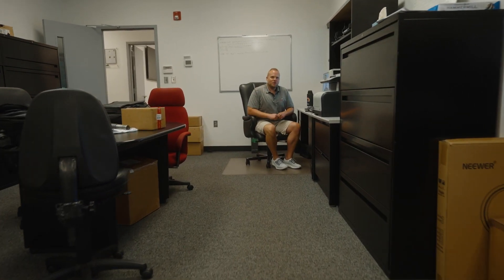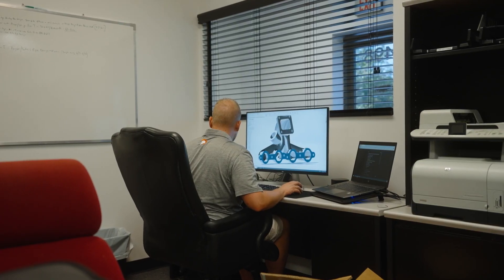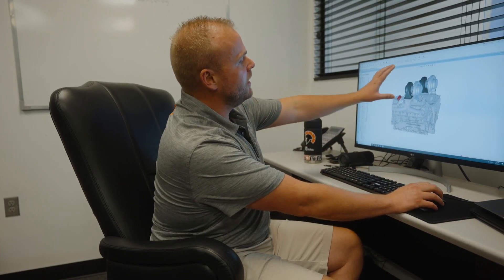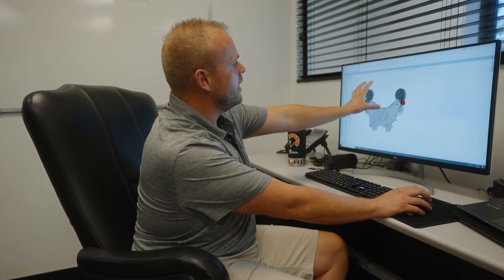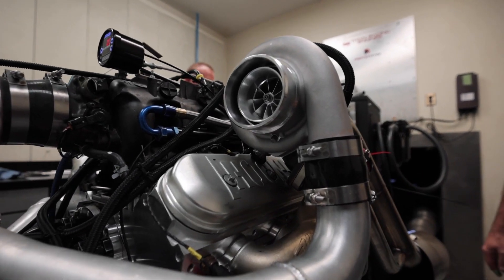Let me tell you a little bit more about our twin turbo LS manifolds that we're working on. This process has been going on for some time, but the original idea was to have maximum compatibility in the maximum number of vehicles using the LS platform. So naturally the place to go was up and high, so we've hugged the turbochargers on top of the valve covers so that it can fit width-wise in the maximum number of vehicles.